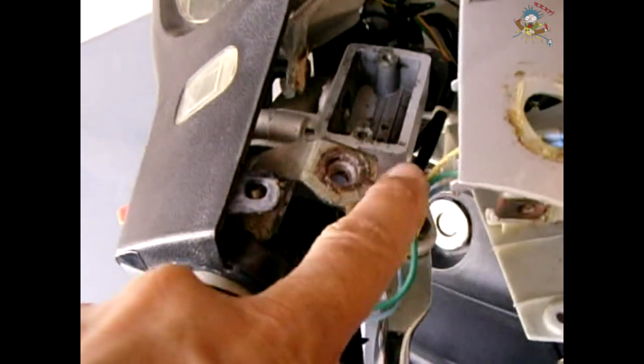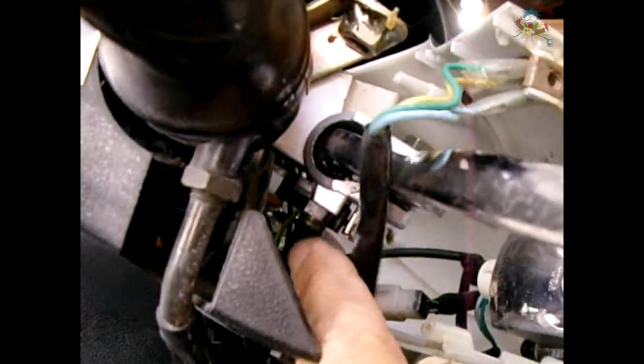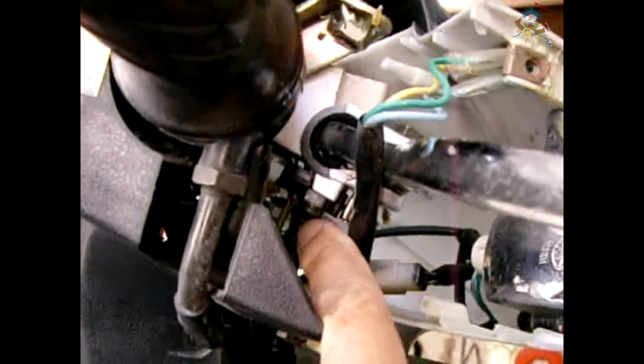Also connected to the underside of the brake cylinder is a micro switch right there — it's hard to see, it's black. That's the clicking you hear. Sometimes they could become faulty and your brake lights may not work properly.